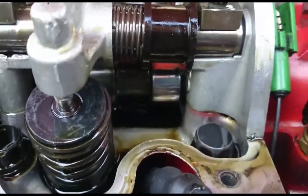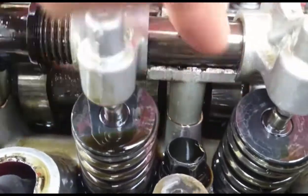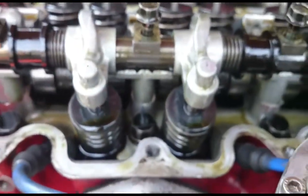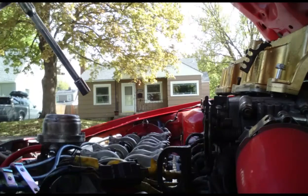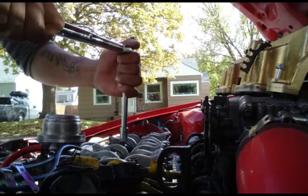When you're putting the rocker shaft on, you have these plastic spacers that space the rockers out properly so things don't end up where they're not supposed to go. Make sure all of those line up before you bother screwing any bolts down. I've already torqued down all of the rocker shaft bolts, and now I'm going to go through and recheck each and every one of them.